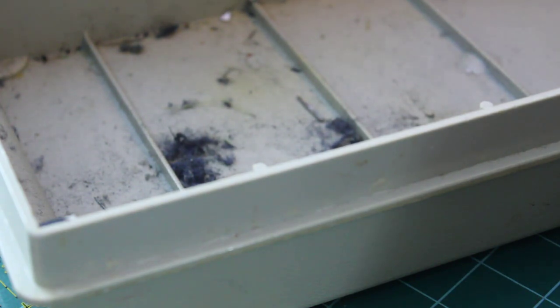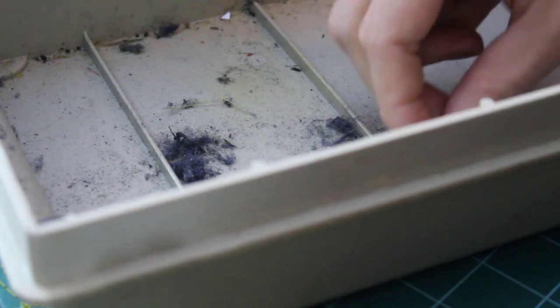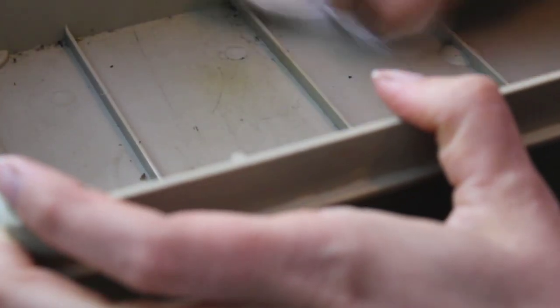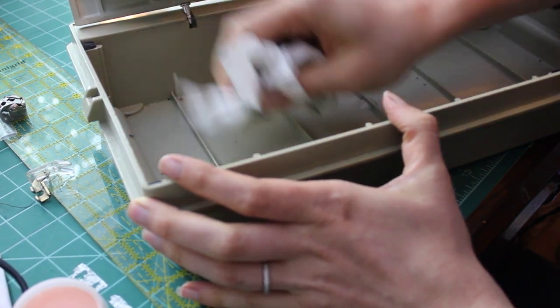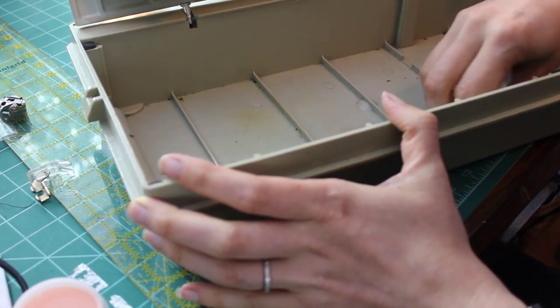In there you can see I definitely have to give the inside of the cabinet a clean. Before I get in there with my can of air, I'm going to do that first, because if I were just to blow air in there, it's going to kick up all that dust and that's not going to do me any favors. I can see bits of broken needles — I'll get rid of them so I'm not stabbing myself. I'm just going to use a wet paper towel to grab all of this; you could vacuum it out if that's easier. I'm not touching the machine with the damp paper towel, so I'm not getting moisture on the machine, and by the time I close this all up, it will have air-dried.